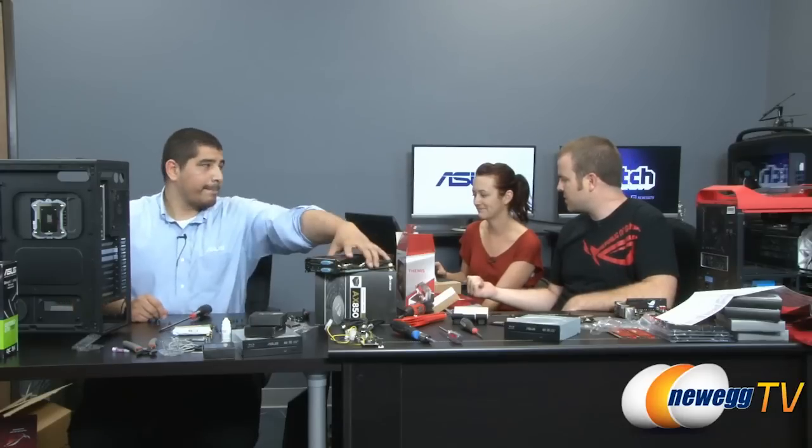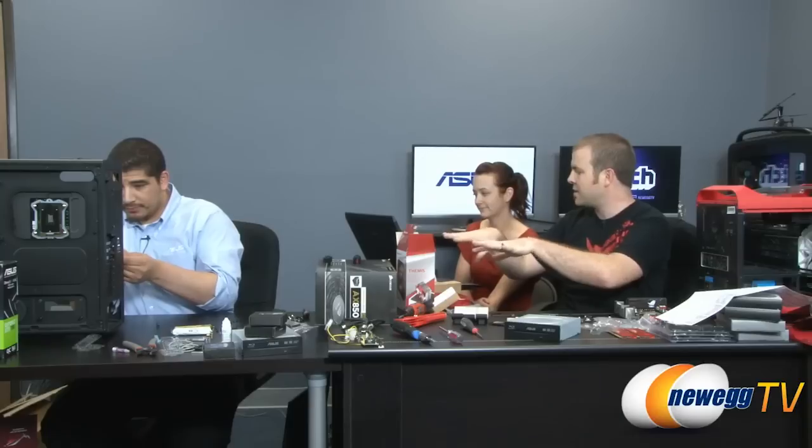We've taken this on the road and used it for video editing before, and this is not even Sandy Bridge. I always forget the code name. What's the 1156 code name? Lynnfield. I think there's a Lynnfield chip in here, and the cooling design on it, the fact that it pushes all the heat out the back, does great. If you've ever used a laptop for something like gaming or video editing and had your hand right next to the exhaust, with heat coming out on your hand, this pushes it straight out the back. Even with some fairly heavy-duty video editing, we were using it at CES a year and a half ago, and it does a really good job.